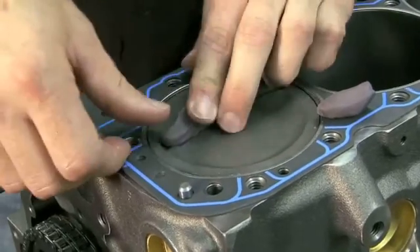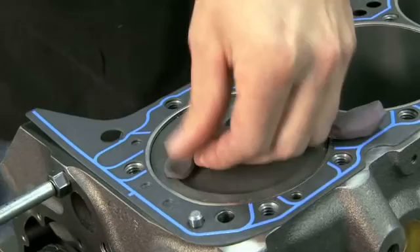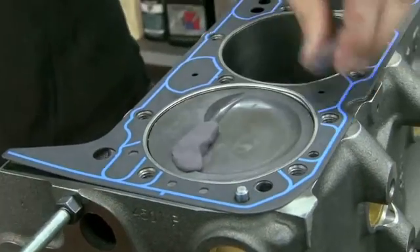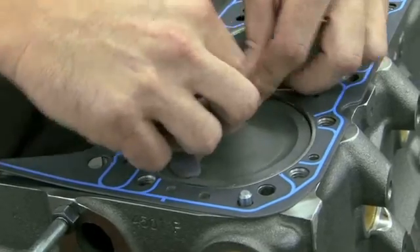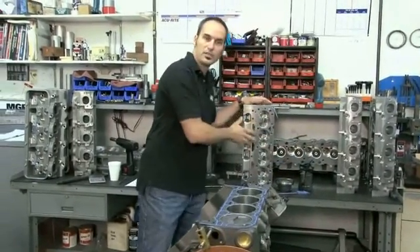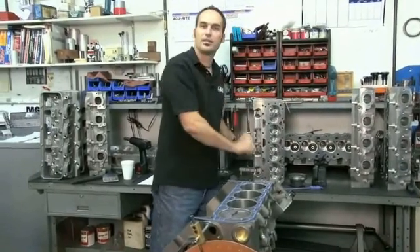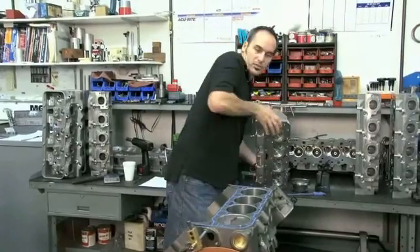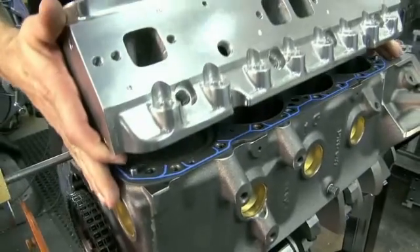Your kids probably got some — just grab a little piece, don't tell them. Come over here, clean the piston off. That will make sure when you put the clay down it sticks nice and tight. Then come over to the head side and take a little bit of oil and wipe down the valves a little bit. That makes it slippery so when we push the valve down it'll make an impression, and when they lift back up the clay will stick right down on top of that piston.